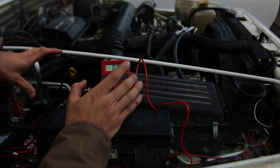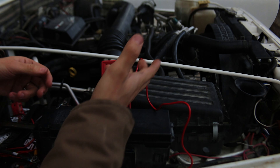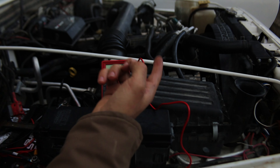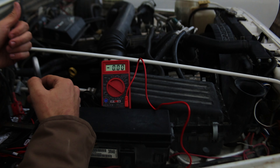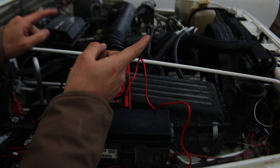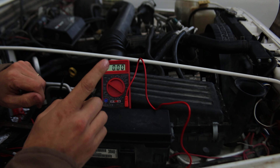Once you've done this and realize there's no voltage there, you know your grounds are pretty much good. The next thing you'll want to do is have a charge test done. You can take it to any auto parts store — I went to AutoZone and had them test the alternator and battery with the Jeep running. They said the regulator failed. So I then took the alternator out and had them test it separately — they said the alternator passed. The alternator has both failed and passed according to them, but we know the regulator is in the computer, not the alternator. The battery is a week and a half old — I just replaced it and had them test it too. Now we need to repeat the ground test with the Jeep running to make sure we don't get any voltage going through the system.